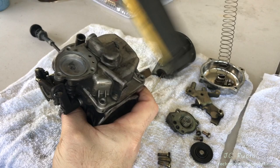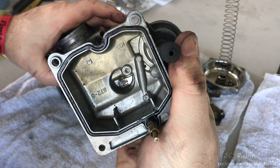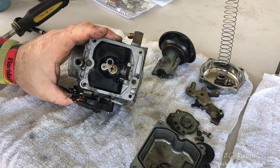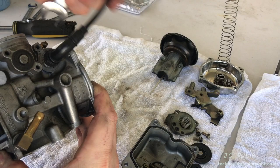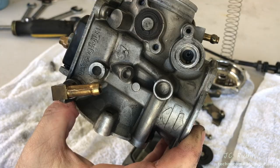The four screws will now be removed that hold in the bowl cover accelerator pump assembly. A couple of wraps with the rubber driver head loosens the gasket. Pulling straight back clears the bowl cover from all the parts inside. Looking inside we see very little contamination on the bottom of the bowl — very nice. Before we go deeper, I want to remove the choke first, using a 9/16 to loosen this plastic nut, then spinning the entire unit until it comes out of the carburetor assembly.